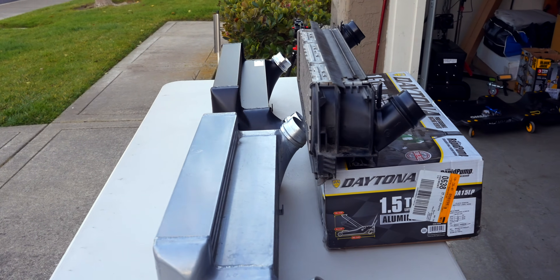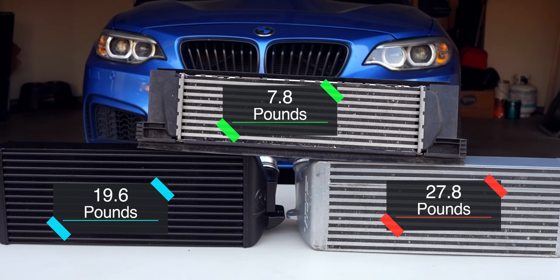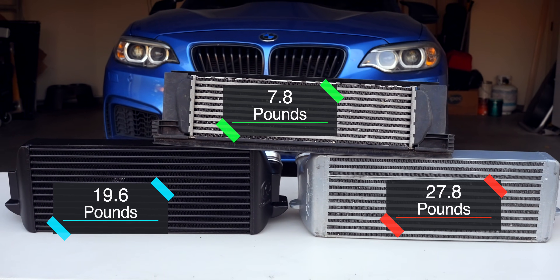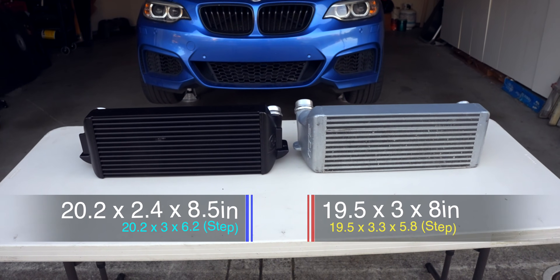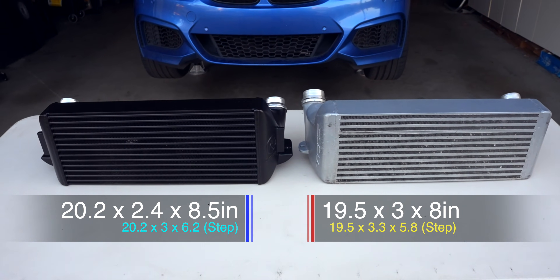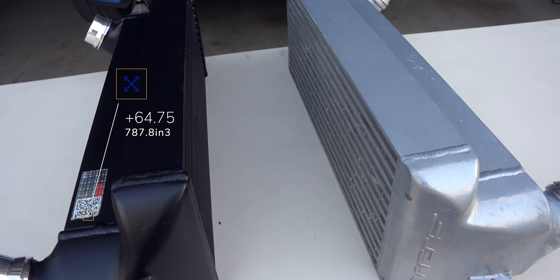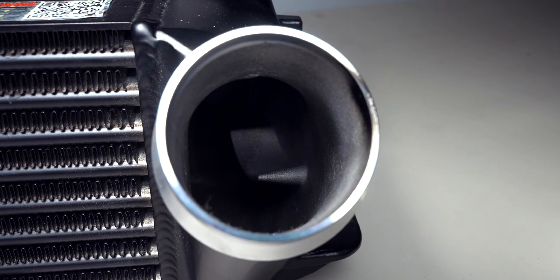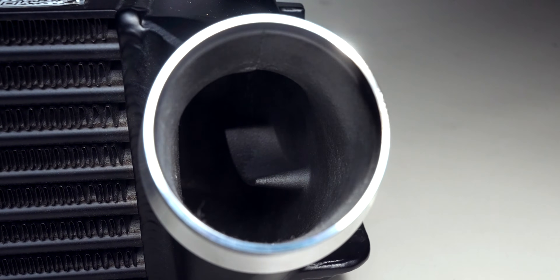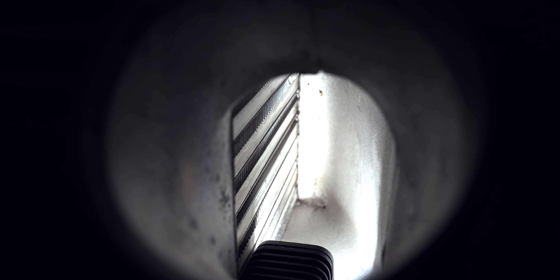But both are also heavier than the 7.8 pound OEM intercooler. The Evo 2 comes in at 19.6 pounds and VRSF is 27.8 pounds. So let me know your opinion — are we really dropping 8.8 pounds up front or are we adding 11.8? When we look at just the Wagner and VRSF intercoolers, we do have a slight difference in their fin to fin dimensions. The VRSF intercooler has the most cooling capacity with a 75.92% volume increase from OEM versus Wagner's 64.75% increase. Wagner also has vertical guides to help align the intercooler properly into place. The last design difference is inside the hot side where the boost pipe feeds in — both the Wagner and OEM intercoolers have a lip to help separate the incoming air, but this is absent on the VRSF design. When we get to the testing portion, we'll see if any of these measurements or design differences have an impact on performance.